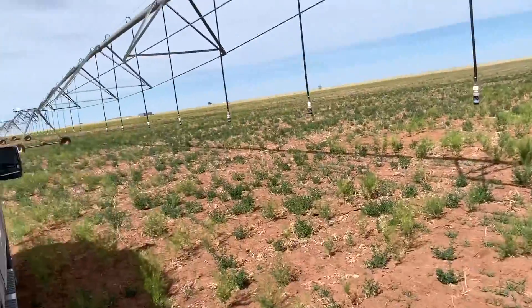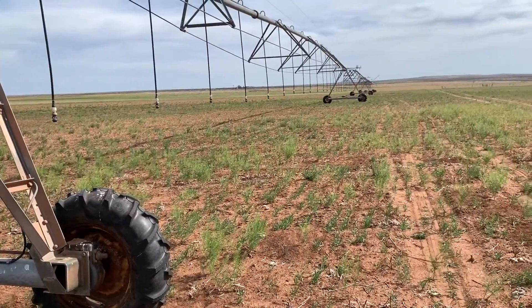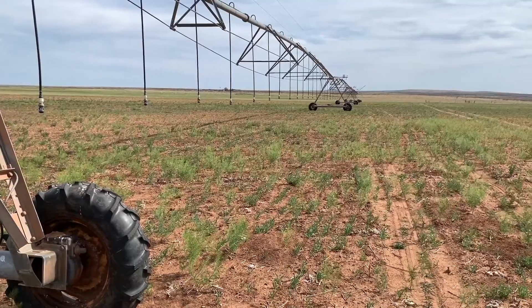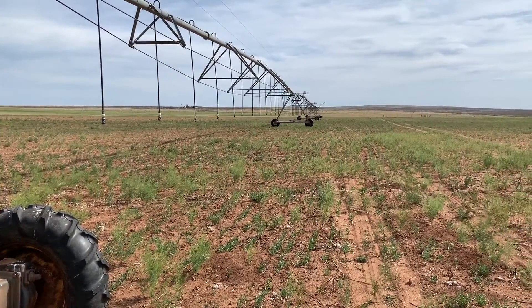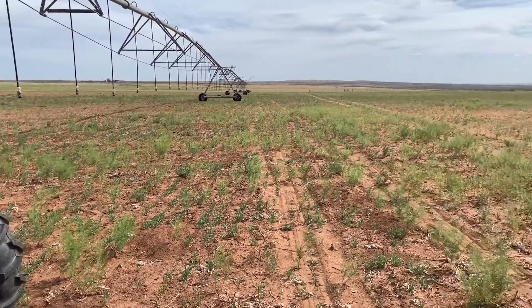Check the oil on this one — we've got three more, then we're done. Now, who can tell me what I forgot on that last one? I forgot to check the tire pressure — that is very, very important. Sorry about the wind noise, I don't have fancy camera gear yet. Some of these tires are tubeless, so we've got to put about 40 pounds of pressure in them.